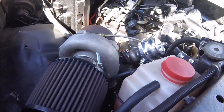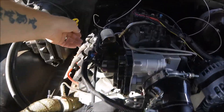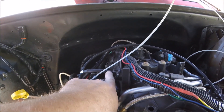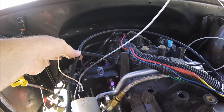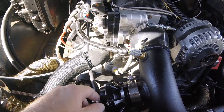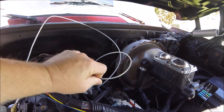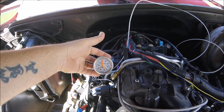Hopefully it won't leak. Our blow-off valve is all hooked up, and here is the tubing I was talking about. I ended up cutting the end off this nipple right here, ran a tube out to a splitter — we've got the fatter line going to our blow-off valve and the thinner line is taped into a boost gauge at the moment because we're going to start this thing soon.